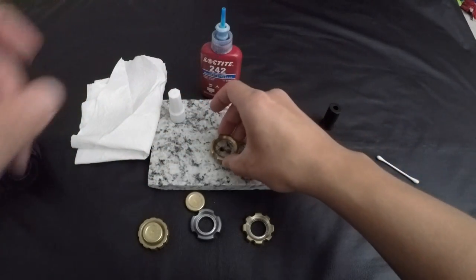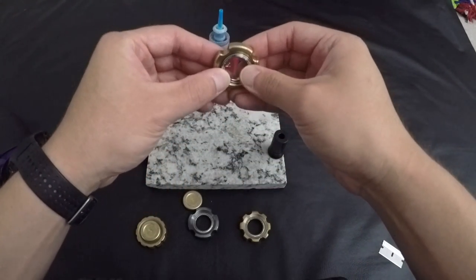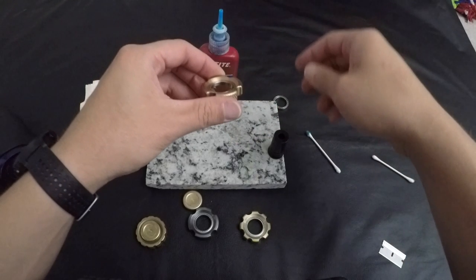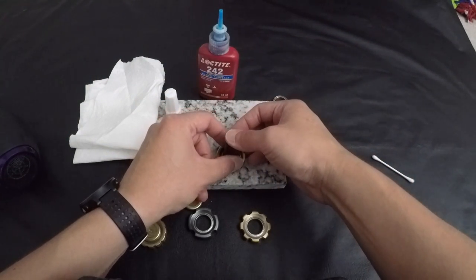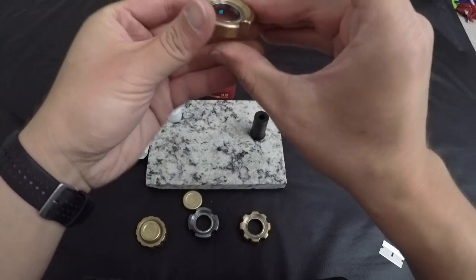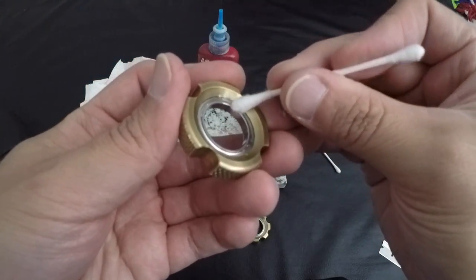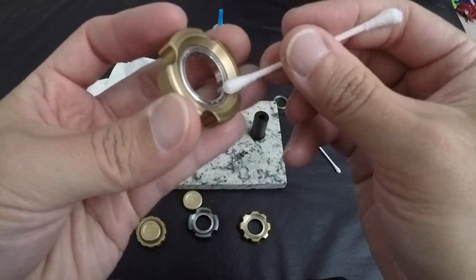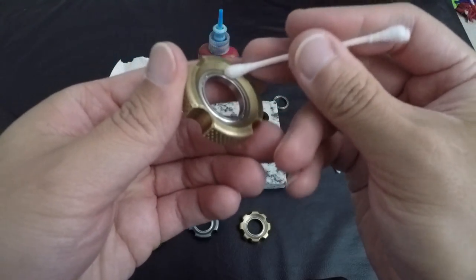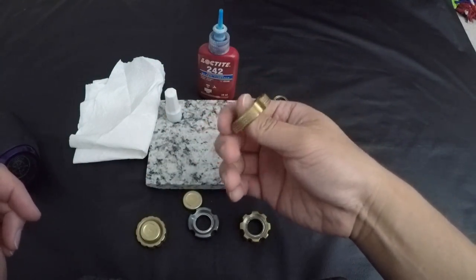Lip side down this time. Now you'll want to get it just right — it's really a tight fit, so it's easy to get it kind of cockeyed in there. You can actually use your fingers to get it started; you'll see it's almost all the way in at this point. Then use your flat surface and your larger piece to push it down in and we should be good to go. That is it. You can actually see some of the Loctite pressed out a little bit, so use your Q-tips to clean that Loctite out. The cure time on the blue Loctite is 24 hours.